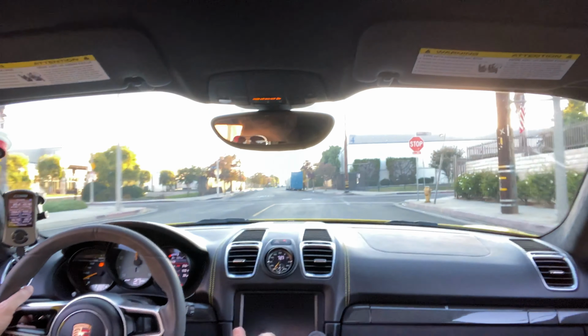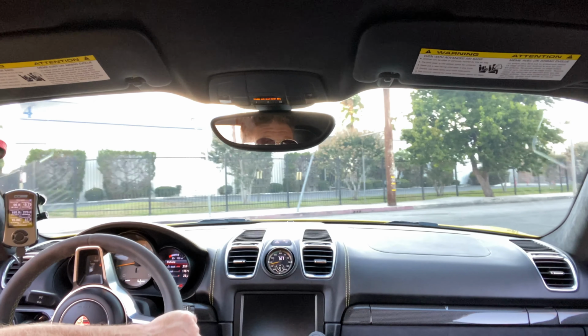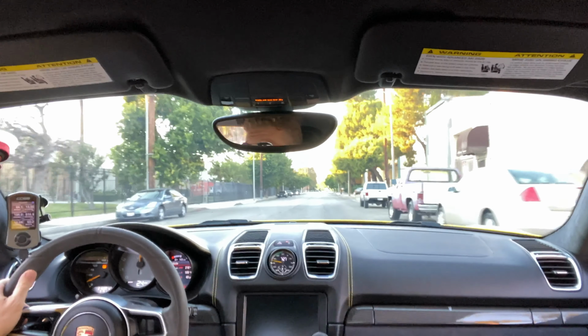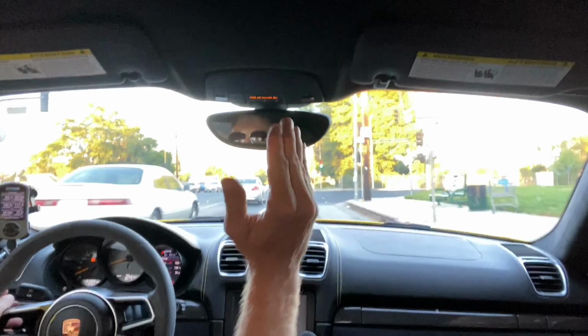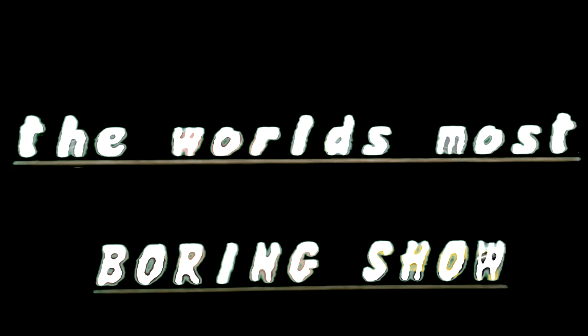Oh, this is going to be fun. Car is going to be a blast. Wow, the throttle response is off the charts. I noticed while giving it throttle, in certain areas the power band kind of dips down and comes back, because of E85 and the stoich value of the fuel. I'll see you early tomorrow morning for our remote tuning session in 3, 2, 1.